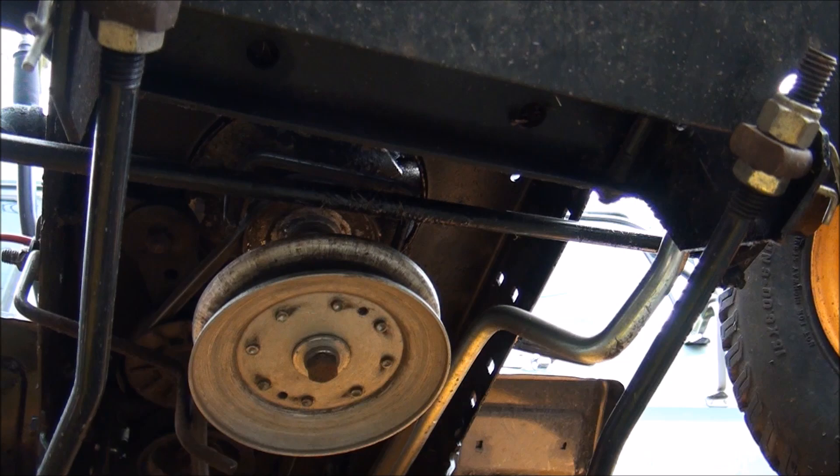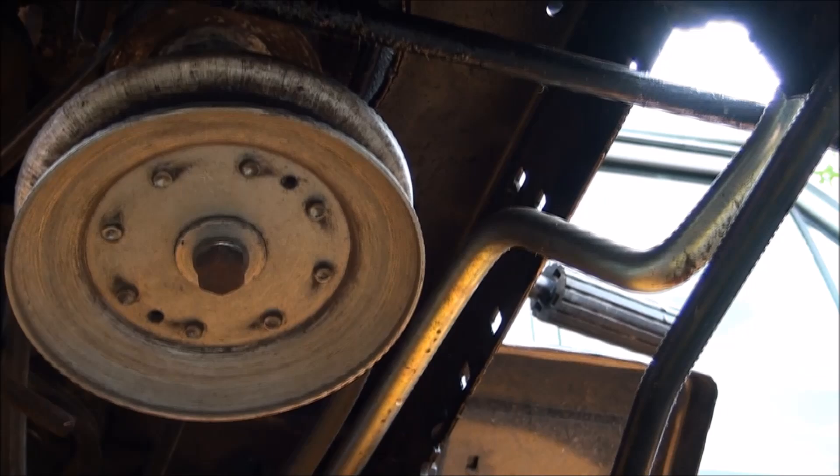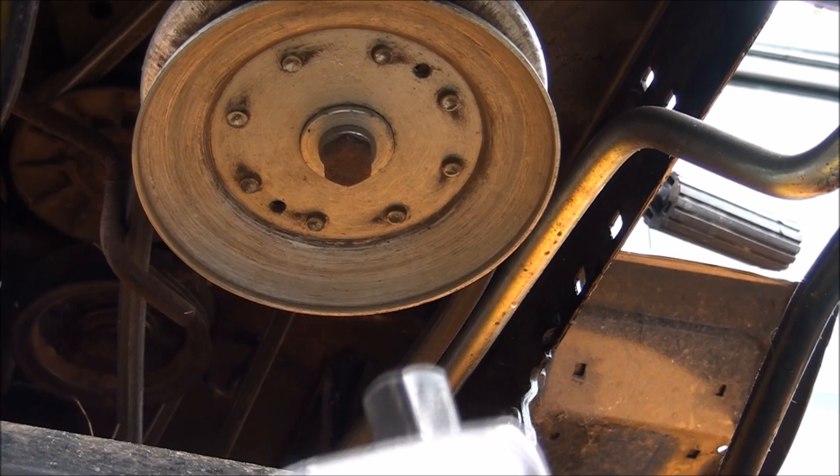The first thing we want to remove is the main pulley bolt, and then we have four engine mount bolts — one there, one there, and there's two back up in there. This part can be really tough if you're just using a regular socket wrench because the pulley spins when you're trying to loosen that bolt. Some of the ways I used to get around that: I would use a pair of vise grips up on the pulley collar and try to lock it in place — it's pretty old school.